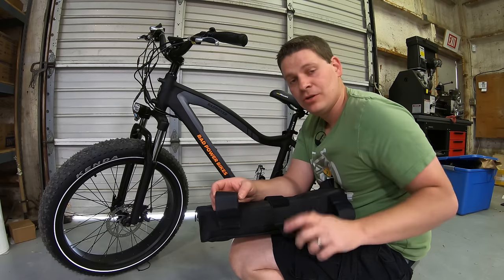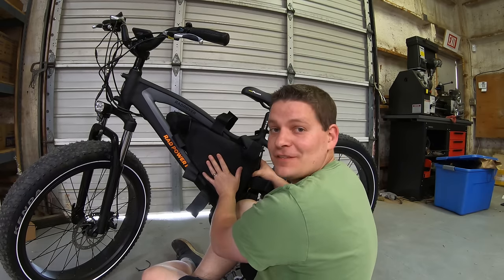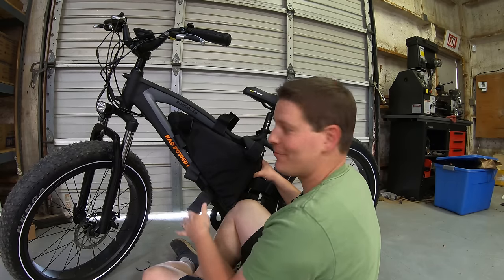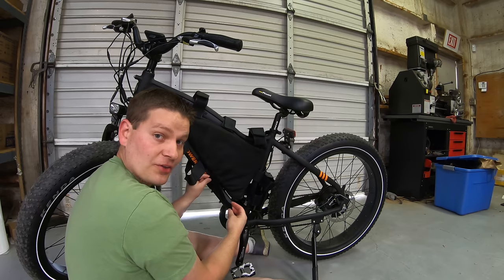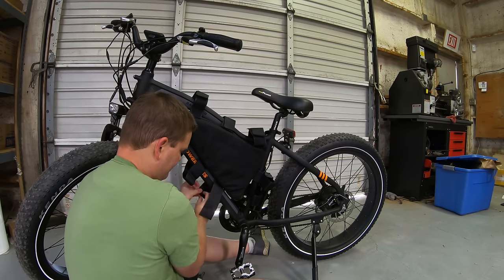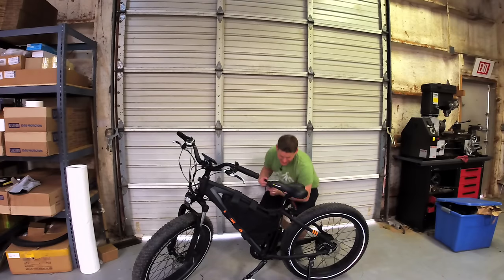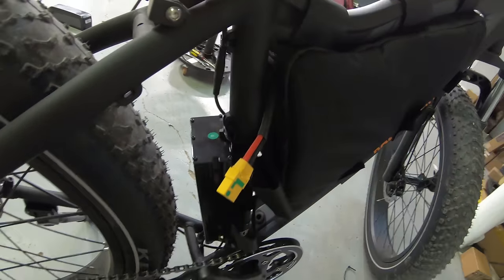After you get this situated on the bike, you can always trim the straps up a little bit with some scissors. This battery is a very tight fit — this is the 52 volt 20 amp hour — so you can see why the larger 52 volt 30 amp hour battery we have will not fit on the Rad Rover bike. We've got our battery positioned right here. Now we can take our velcro straps — you can see how this is a little bit longer than it needs to be, so we could trim that shorter. However, this may or may not be the permanent home for this battery, so I'm going to leave some extra room and just tuck that underneath in case we decide to move this battery to another bike. Here's the battery cable for our big triangle battery, exiting out of that hole right on the back corner that I showed you earlier.